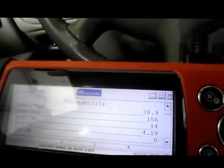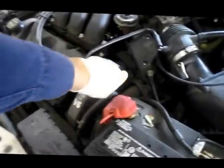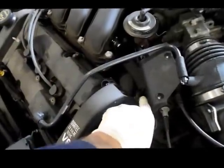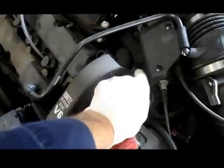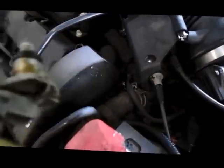You're not going to believe this — let me show you what I did. Now we're underneath the hood and the coolant temperature sensor is right down in the side over here. Obviously you don't want to be doing this when the engine is running because you have a fan belt right here — it'll definitely cause a problem with your hands. So let me grab that new sensor. This is the old sensor I took out of there. The sensor sits in there like that — you rotate it this way and pull it straight out — then plug the new sensor on.